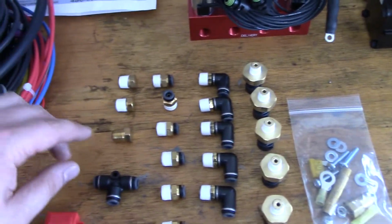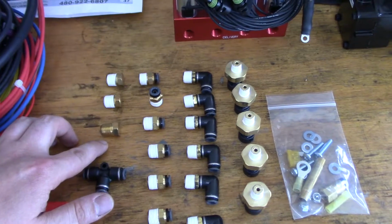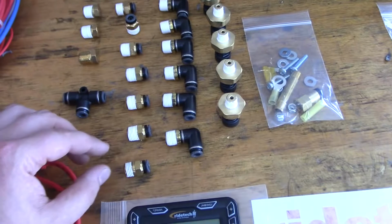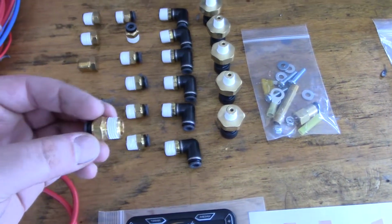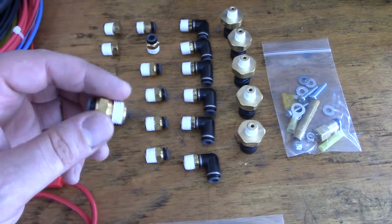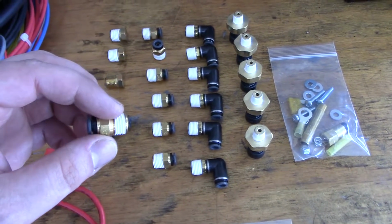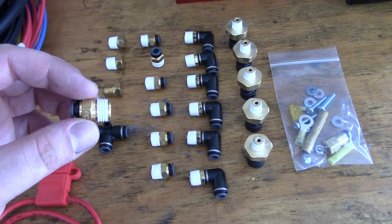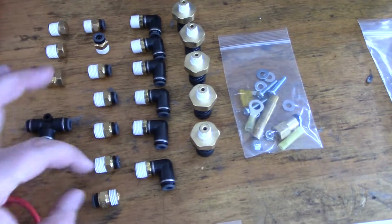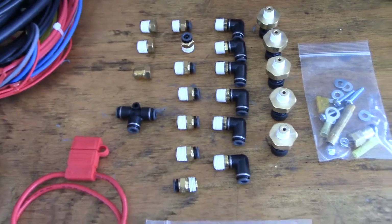3 plugs. You can see that this one does not have tape on it, Teflon tape. I went ahead and taped all this up. These guys here came with this tape already on it. I work in HVAC for a living, and I will tell you that this stuff is not really that great, and I'd go ahead and put 2 to 3 wraps of Teflon tape over top of these. So I'll do that one in the plug, of course.